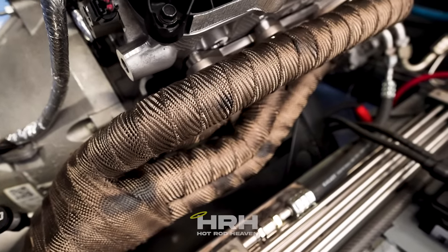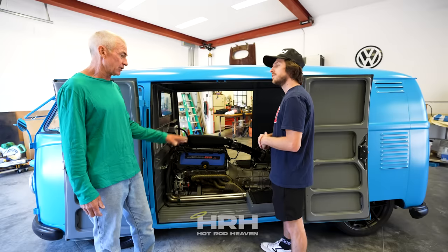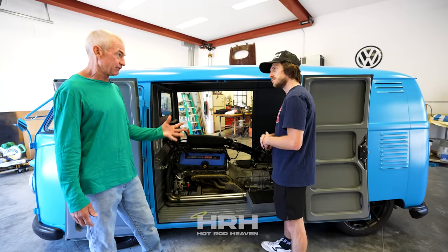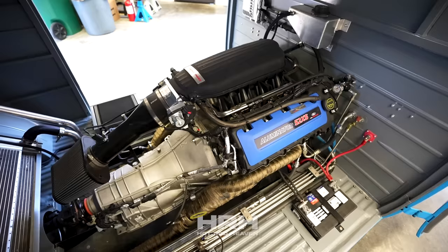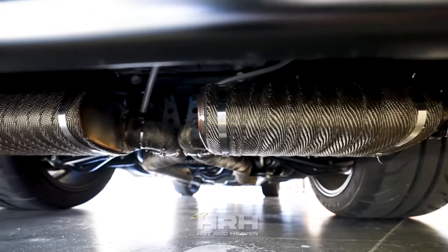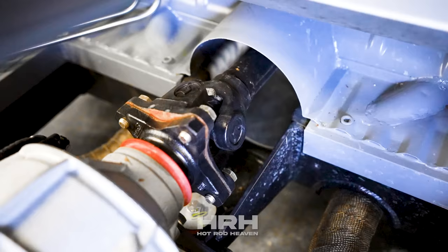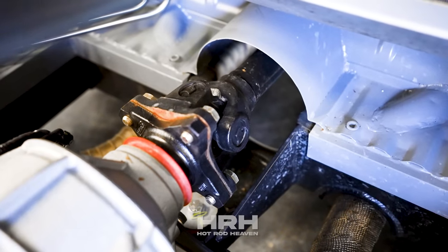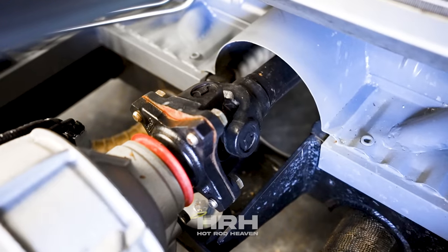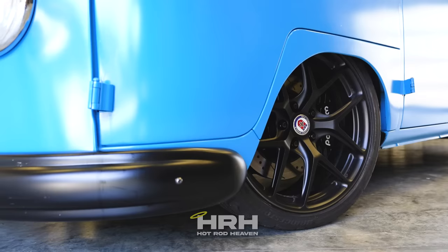To change a tire you actually have to drop the whole rear end out — pretty crazy. The headers on there are stainless, made by Ultimate Headers. The width of those headers was actually one of the driving factors on the dimensions going to Art Morrison. They make quite a few selections for Mustang, Fox bodies, and Coyote swaps — those particular ones are the tightest ones, which helped out a lot. It's got Magnaflow mufflers on the back giving it a nice sweet sound. The driveshaft is pretty short — like nine inches long — it's actually just a slip yoke, no tube shaft.